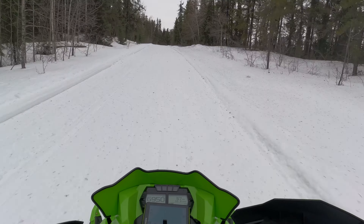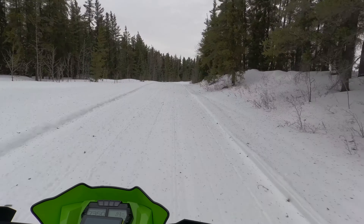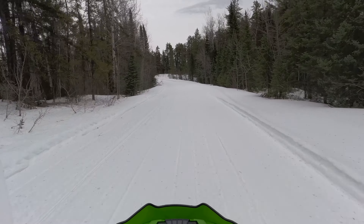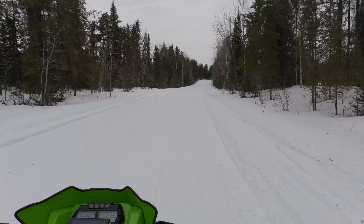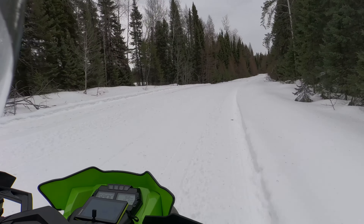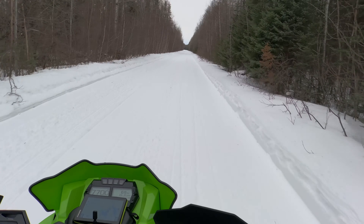In terms of front end handling, just coming around the corners here — first impressions. I know from Jason this has stock carbides. It handles quite well. You point it and it goes. There's a little bit of push, but if you lean into the turn, that kind of eliminates it. Jason has a set of six-inch triple points he'll throw on the sled, and I think that will cure his issue entirely. Comparing Polaris, Ski-Doo, and Arctic Cat two-strokes: the Polaris front end handling is the best out of the box, and the Ski-Doo is the worst. This sled is definitely a close second. Jason hasn't done basically anything to the front end and it handles really, really well.